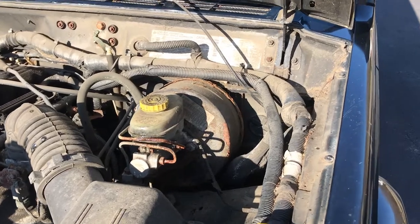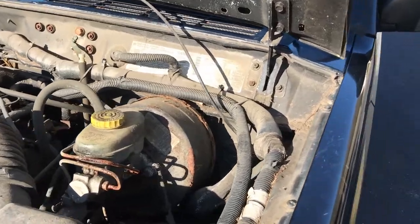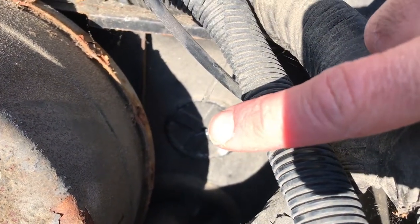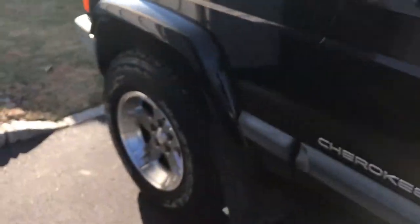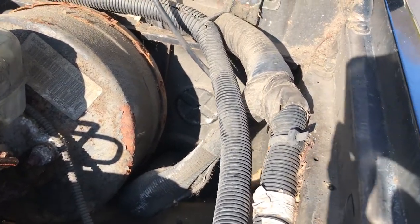Alright, so I'm outside now. I'm going to run the wires. Don't mind the sirens — it's Christmas time and they've got Santa on the safari truck driving around town. I'm going to go right there. See that X mark? X marks the spot. I'm going to drill a pilot hole there and use this half-inch grommet. I'm going to put a half-inch bit on it. And that basically comes right down underneath. You can see the lights coming through right there. That looks like you can actually knock that plug out — I've seen people do it. But I'm just doing it this way, putting a grommet there. And this way I can feed more wires in at a later time. That's the way I'm getting the wires through the firewall.